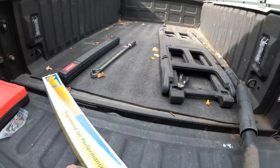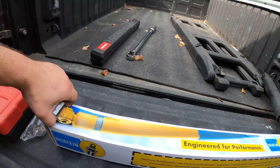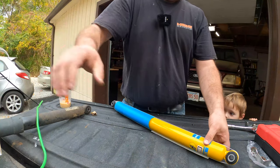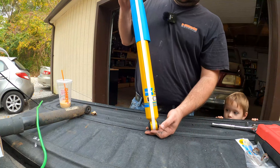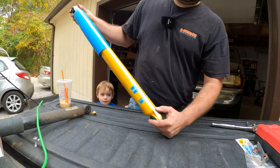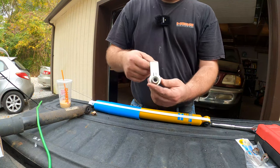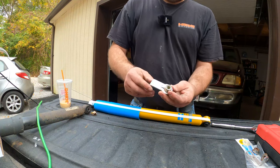We're going to open up our new Bilstein shock absorber — I'll put links to these in the description. I think that's the 4600 series. There's our shock absorber. There's a sticker for your toolbox or your truck. We want to leave the strap on it so it doesn't decompress all the way, otherwise it'll make it that much harder to get into the truck. This is the 4600 series, part number 24-187350. I'll put that in the description as well, along with a link to the Wren Suspension pieces. Pretty awesome tool — well worth the $25 I paid for them.